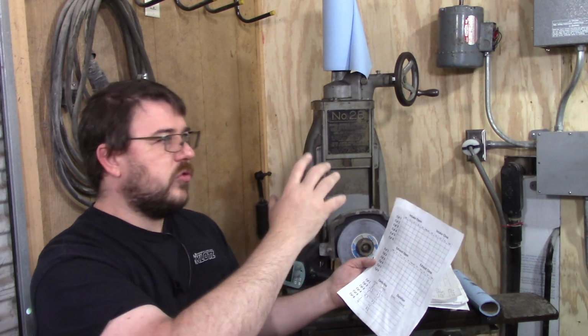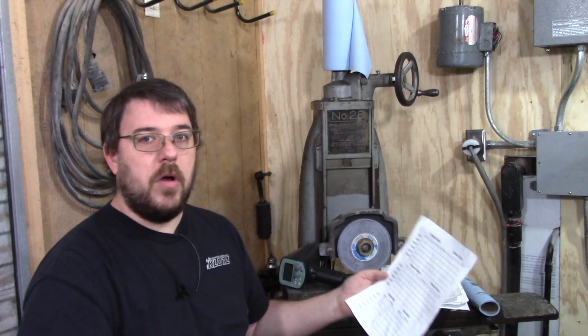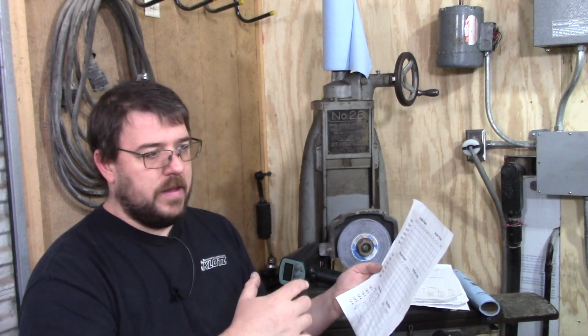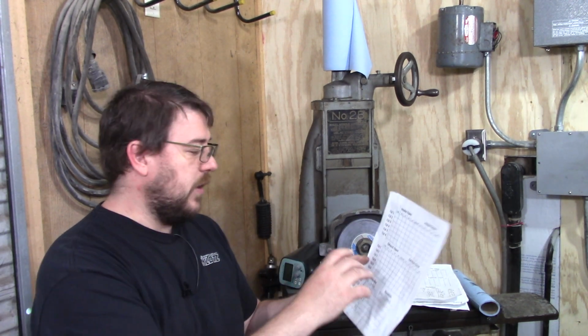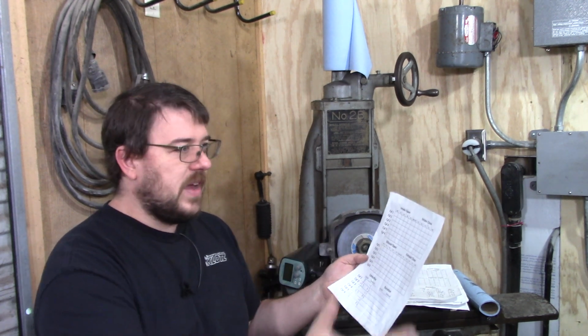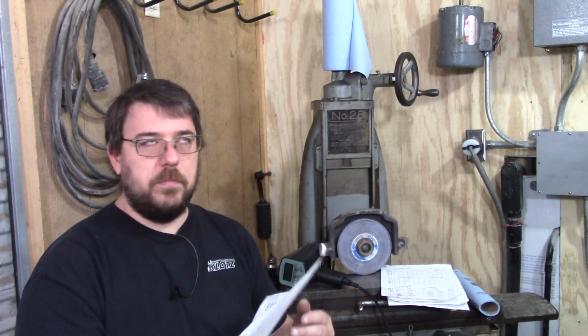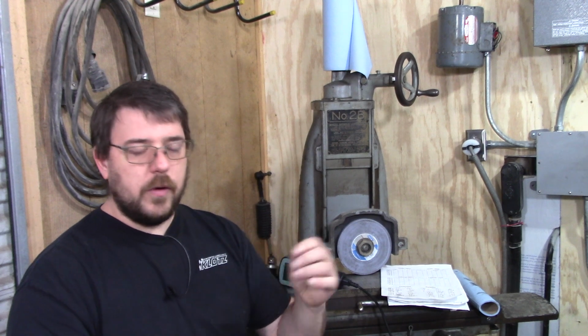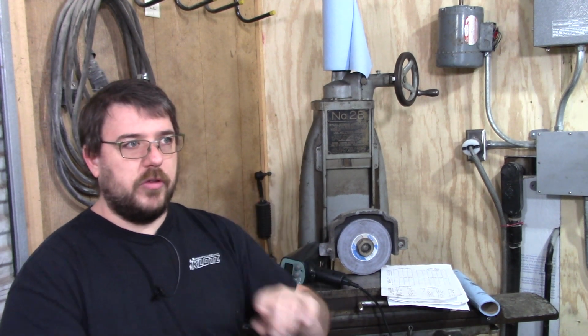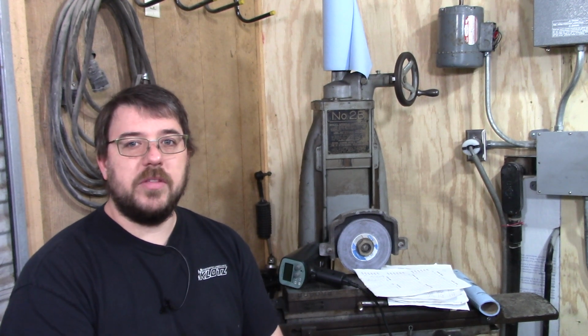So any stretch that we would see on bank 2 would be seen on bank 1 also. And if it is chain stretch that's showing it on bank 2, then that's fine. It just means that instead it's bank 1 that's ground off center line instead of bank 2. So the results are still valid. There's a very, very small chance that the results are actually inverted from what I think that they are. So let's see if we can quantify what this data means.